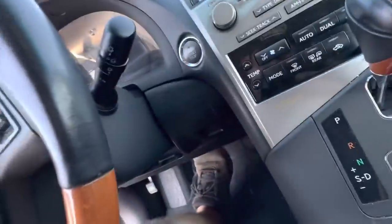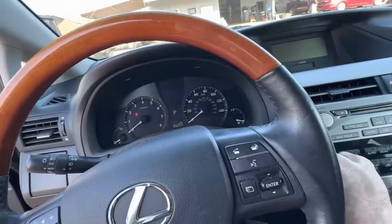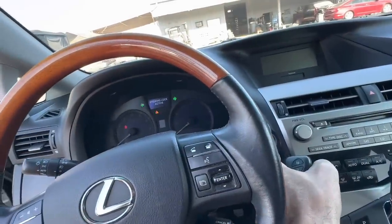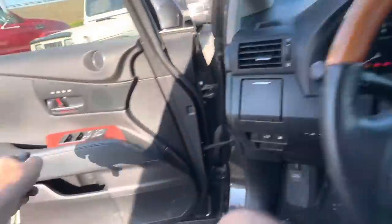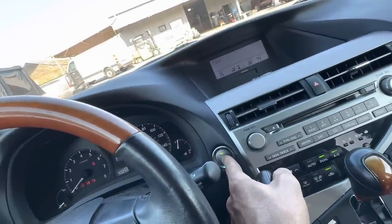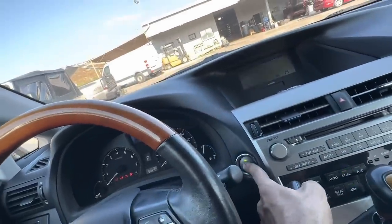Foot on the brake, foot off the brake. Okay, that tells me that the brake pedal switch is working. Starting the engine. Yep, I heard a click from down below, and that is all. Interesting. Nothing. What's the dealio? Starting lock activated? Let's try it with the door shut. Starting the engine? It's a negative. No crank, no start.